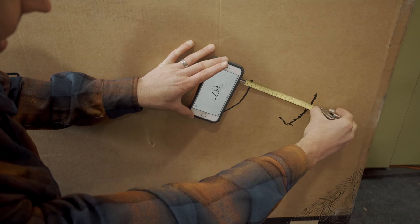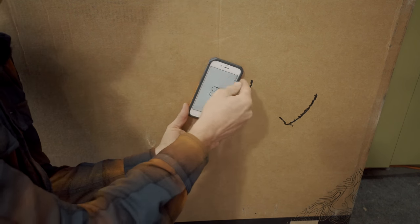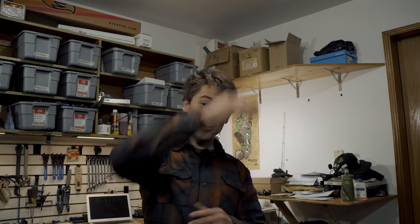This says approximately 30 millimeters. So the distance that it moves back from here to here, that's the change in fork offset. If you notice, the axle path kind of looks like a J. It moves backwards initially, then starts to move up quite a bit.